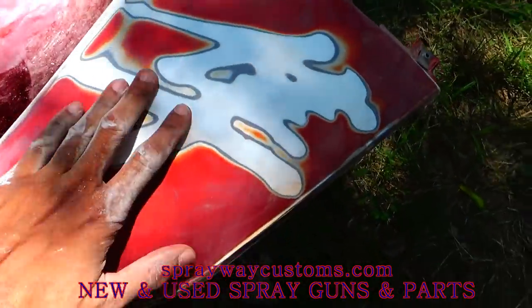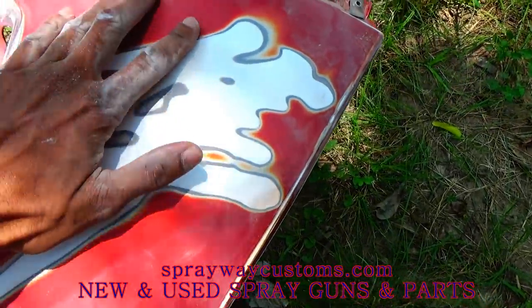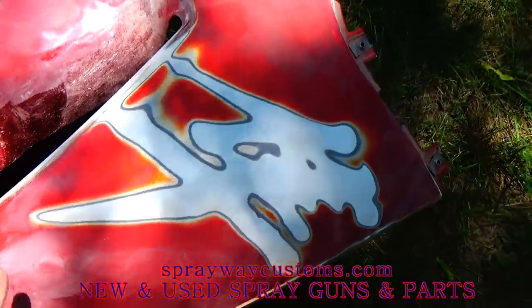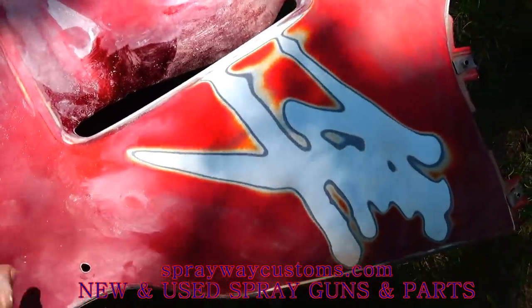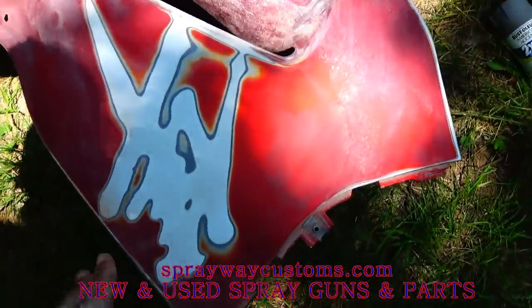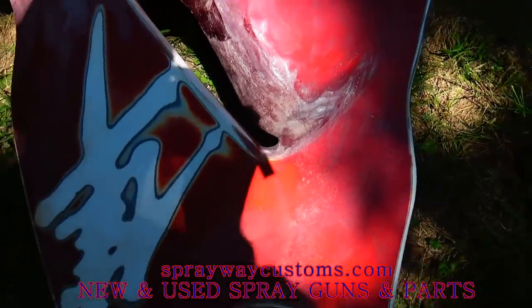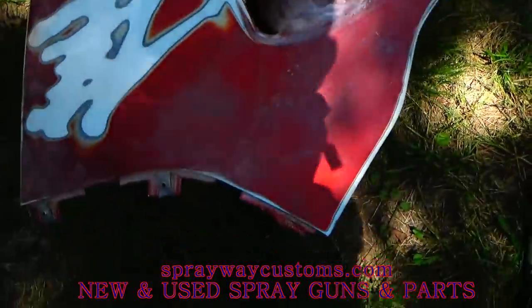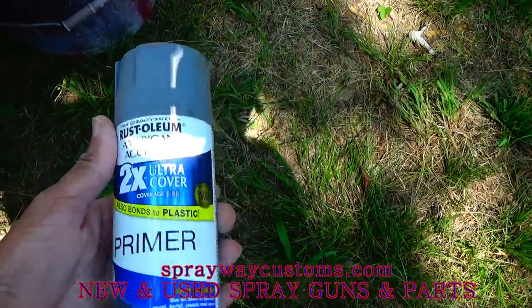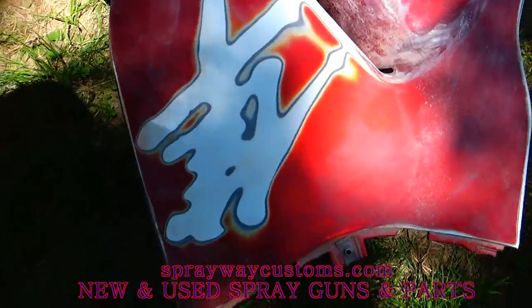But you still want to put some primer on it, because you want to make sure you ain't got no line nowhere. I can still feel one right here. So I'm going to prime it up, just this little area here. I was going to prime the whole bike, but he changed his mind, so he don't want to spend that much money. So I'm just going to prime this, then we're going to shoot the base over the rest of it. I'm going to use this primer I found in the shop. Just can primer. I know somebody might say why he using can primer, but it worked though.